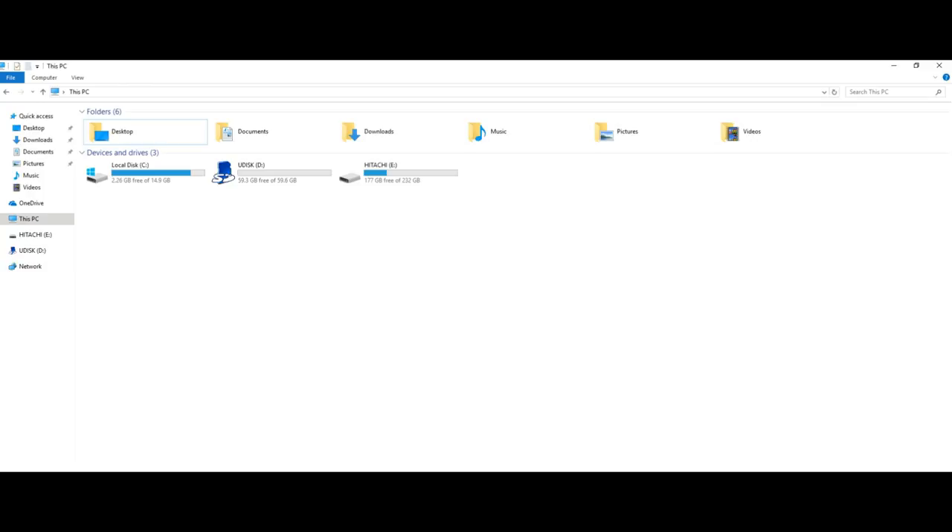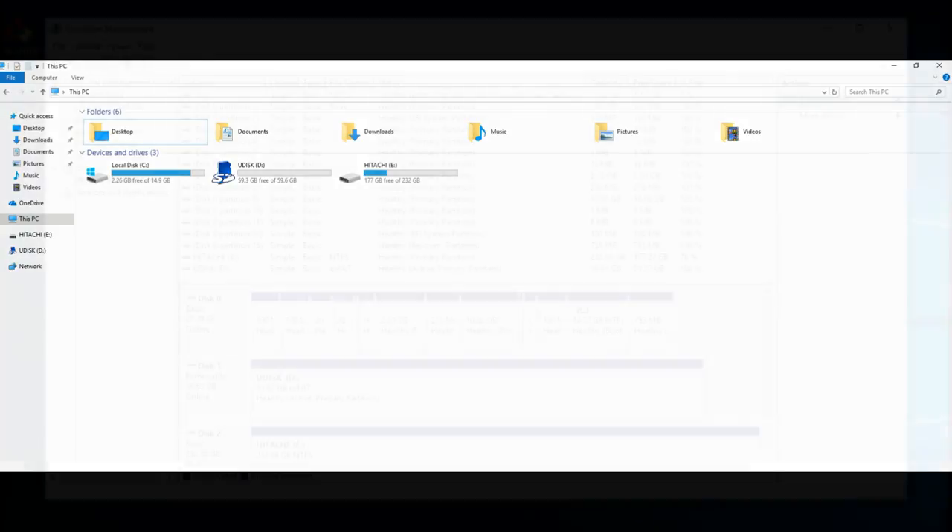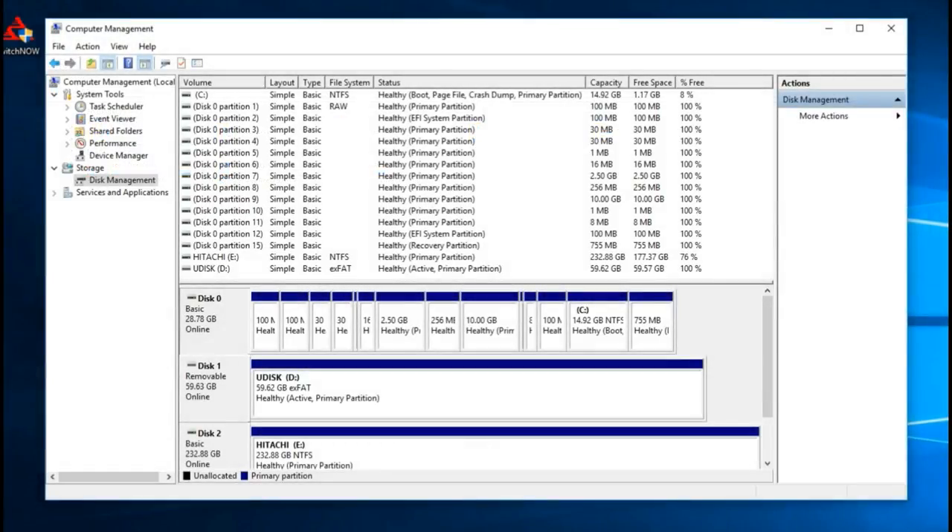Looking at the storage, this is where we start running into difficulties. We only have a couple of gigs left — the most I managed to get off the box was about 3GB, so we're very limited. They've partitioned the drive in a specific way and I would strongly recommend you don't mess around with that. Otherwise you could end up with a black plastic box that doesn't do much. Don't resize or delete partitions unless you know exactly what you're doing — it's a mistake I made myself a couple of times, so I'm passing it on as a warning.